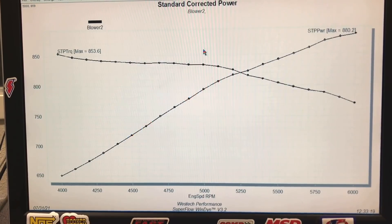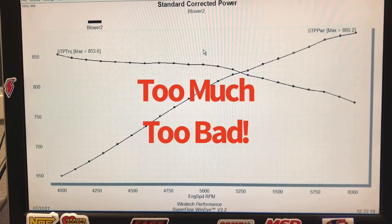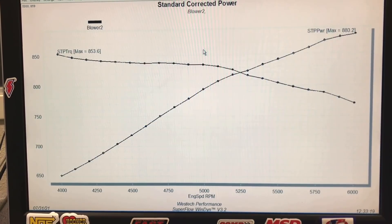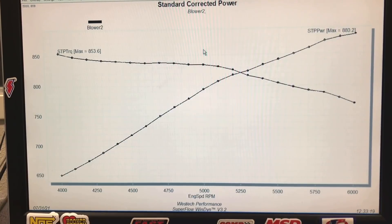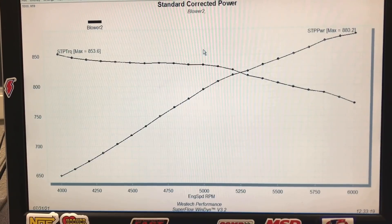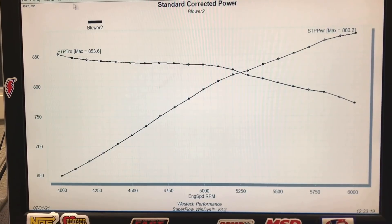James went out and put about two more degrees in it for a total of 30 degrees timing, and that seemed to be where these things run. We've run a lot of them on the dyno, and these boosted combinations on big blocks with that kind of cylinder head seem to work pretty well closer to 30 degrees. You want to be careful running pump gas — getting up near too much timing and boost is risky. But part of the reason this thing could run on 91 octane is: it had low static compression, enough camshaft to further lower dynamic compression, good aluminum heads, cold intercooler water, an air-to-water intercooler, and fuel from the carburetors going through the blower which also reduces charge temperature. All those things combined to allow you to get away with quite a bit on only 91 octane.